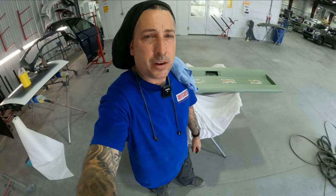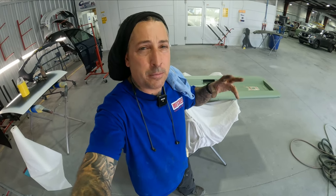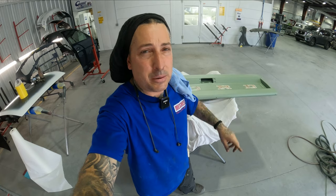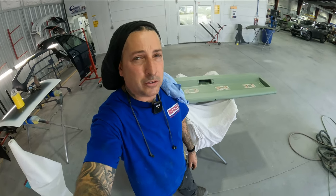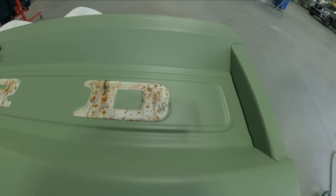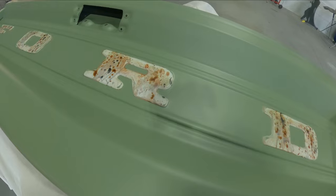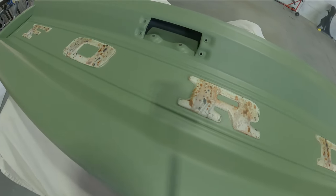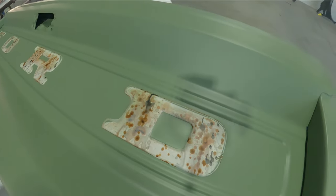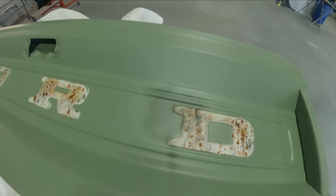It's all unmasked and it's all finished up. We hit it with the satin clear and that's just to give it a little bit of the aged look like the front emblem. I'm no airbrush artist and we just did this as a quickie just to give it a nice little subtle look — and I think it came out nice, we achieved what we were going for. We hit it with the water base, then hit it with the squirt bottle. You guys got to play around with it to get the look you're going for, then put some clear on it to treat it since this is a water base. This truck will be going together and you'll see it all finished up in the next video.